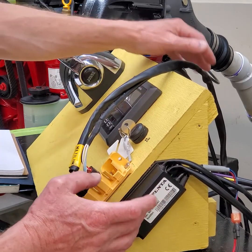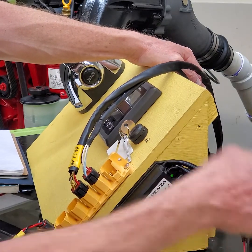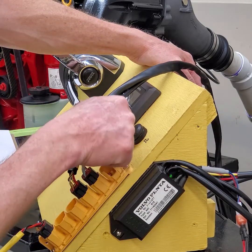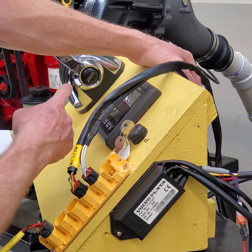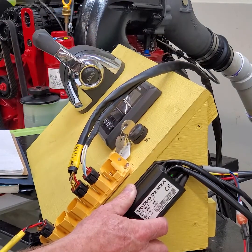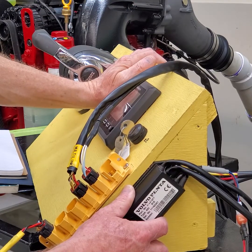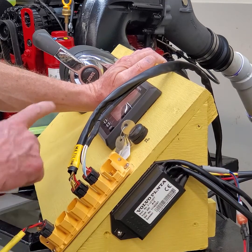Those commands are turned into digital messages — that's called LIN communications. That communication highway then goes back to the HCU as a digital message of key-on or engine crank. If you shut the key off, the key-on message goes away and the HCU commands a stop command. That command goes from the HCU to the PCU to the ECM, and the ECM shuts the relays off, which shuts the engine off on a gas product.